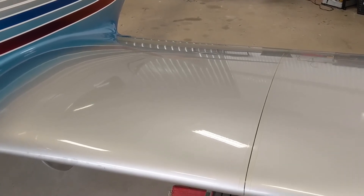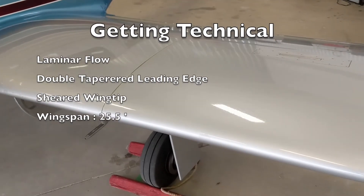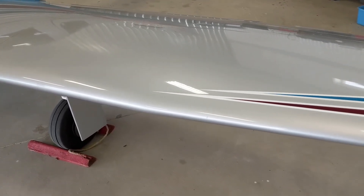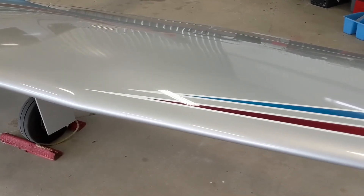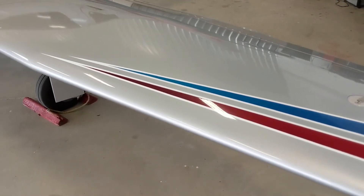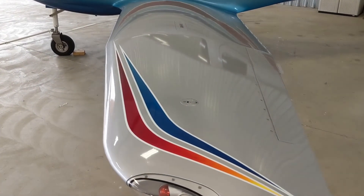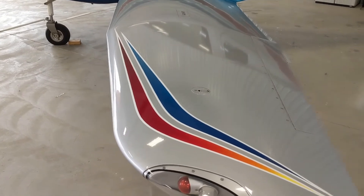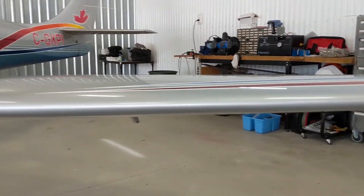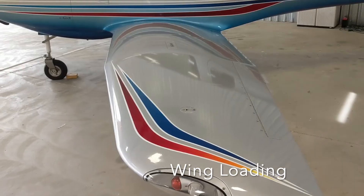To get a bit technical, this is a laminar flow, double-tapered, leading-edge-sheared wingtip wing. It has a relatively small 25.5-foot wingspan — quite a bit less than a Cessna 172 at about 35–36 feet, and a lot smaller than a Cirrus at about 40 feet. One of the tapers is visible here: the outboard chord is narrower than the inboard chord, and the wing also tapers in thickness, getting thinner in both dimensions.